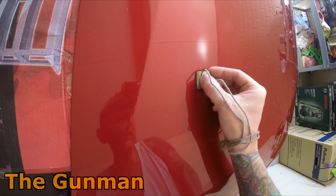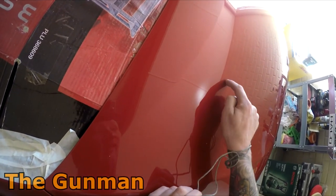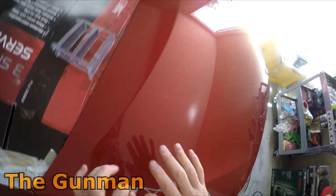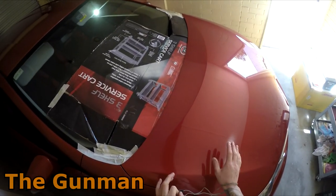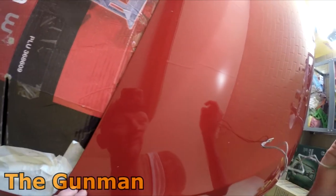And what I like about this is over sanding. So if I was to sand here and have a de-nib 2000 mark, sometimes you polish it up, get it all done, get it out in the sun. It might look fine, but then two days later, you'll see that de-nibbing scratch again. If you're just doing the tungsten mark, the worst case scenario is just one tiny little bit coming back.